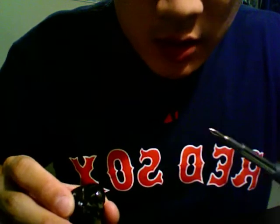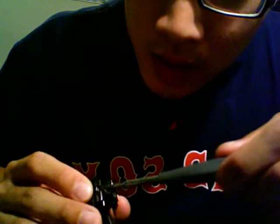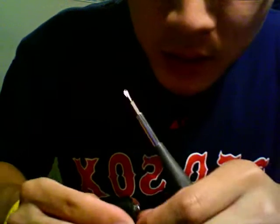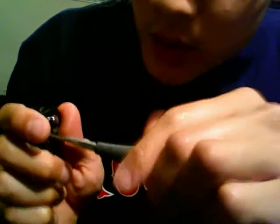So you're going to take that same 1/16 screwdriver that you're using to remove that back screw. You're going to get the silver one first. So here's an up close shot of that. There's three. So you're gonna take the silver one off first, and all these screws are gonna come off really easily. I put a little bit of silicone grease on there too, so that they don't stick as they did before with the Loctite on there. And you're gonna go in a clockwise manner. So start with the silver, go with the black on the right side. That's gonna come off like that.